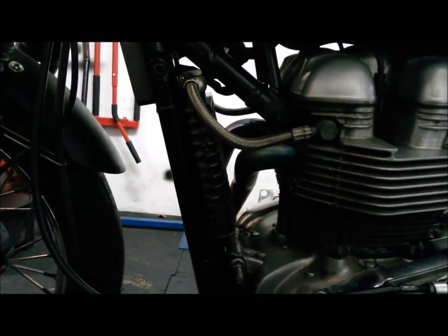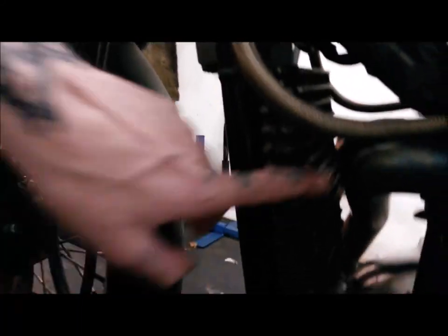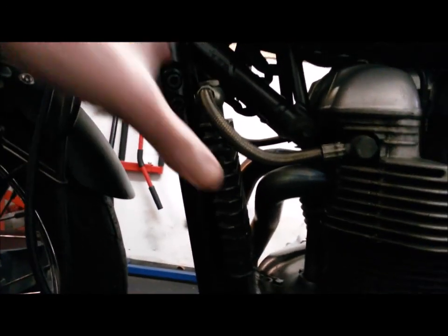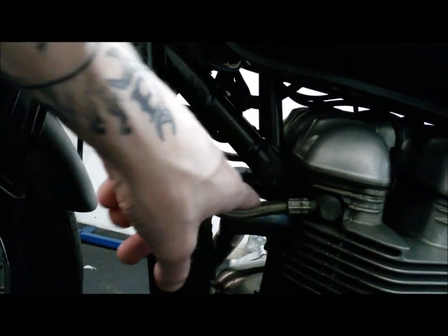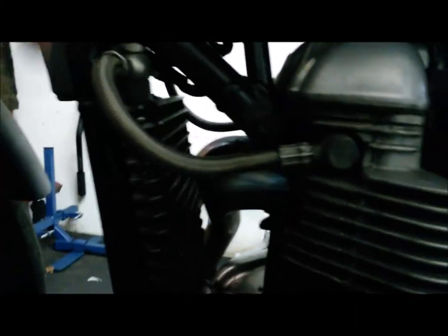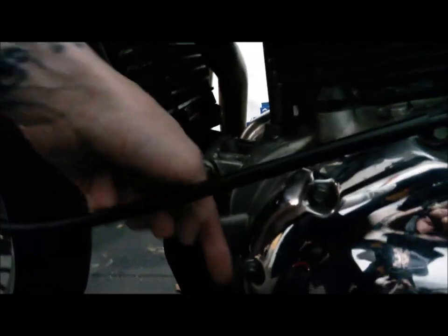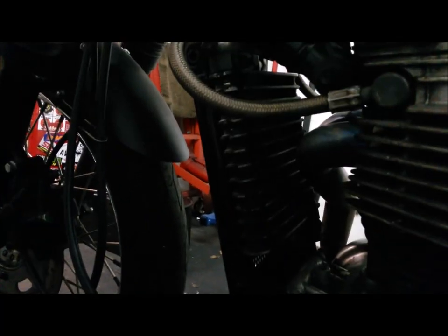So there we go — front of the bike, oil cooler in here. It's not crazy but it's a little bit ugly, especially this one's getting a little tatty. I could do the respray but it's just kind of right there on the front. You've got the pipework flowing this way, oil runners in here, and there's another hose mirrored on the other side. They meet here cooling the oil cooler, and there's an exit fitting on the bottom of the cooler that goes on a pipe flowing around the bottom and into the sump.